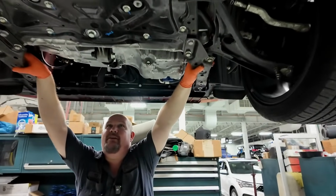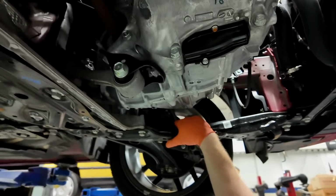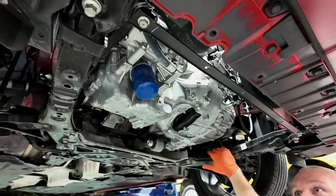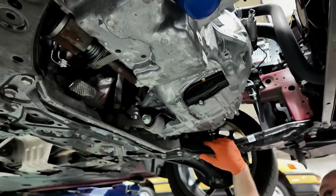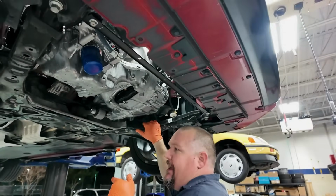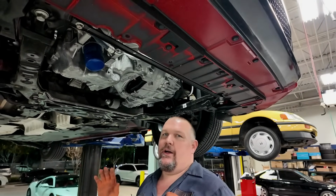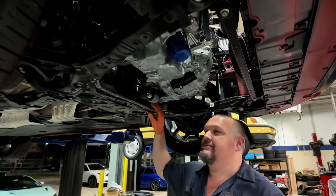TJ, what's next? We're gonna pop in that PRL billet mount and let's go ahead and start assembling this exhaust back. I think we start with a downpipe and then work our way down, or the opposite? Yeah, let's start with the downpipe and the midpipe. That way we can build the cat-back, because it's kind of a slip-on style. So we kind of got to put it on, set it up, twist it a little bit, before we clamp it all down.